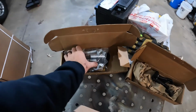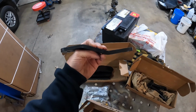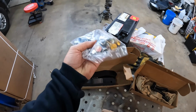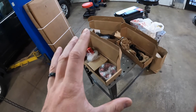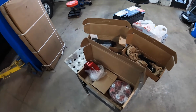And in the back, he's got a couple of 2.5-inch, they're actually beefy as hell. I want to say it's 3/8 thick steel shackles and grade 8 hardware and sleeves. So that's pretty impressive, I must say. Pretty straightforward install. This does not come with the shocks for the rear. It's not required. Could you upgrade them? Oh, absolutely.